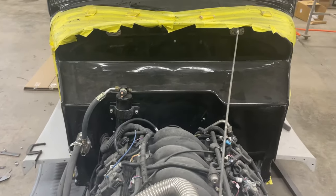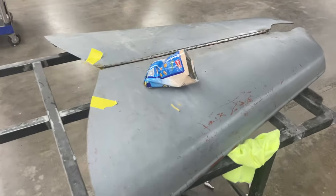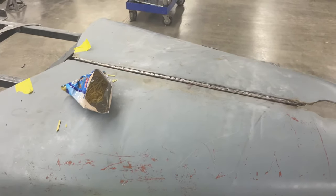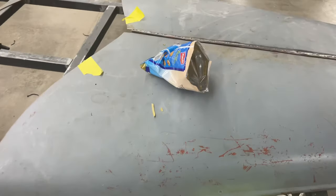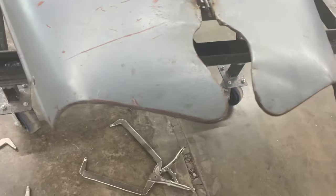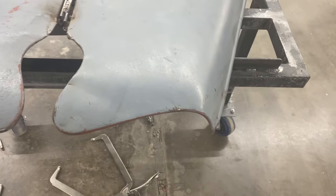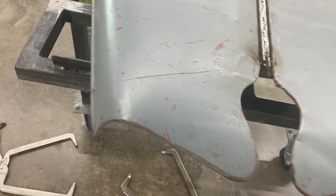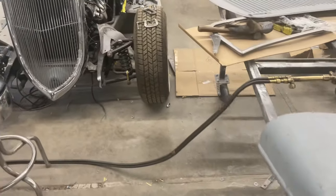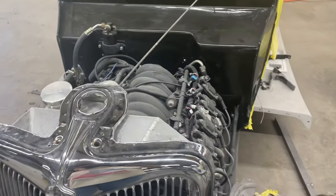Now we're putting the finishing touches on it. What we're going to do is turn the hood into a one-piece hood and hinge it so you can open it either direction. I put some backbone braces in there. Now I need to figure out how to get the front with a nice clean line so that when it goes on that grille shell it looks like it belongs on that grille shell.